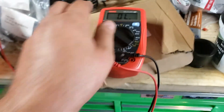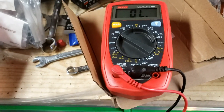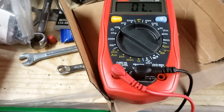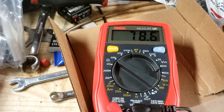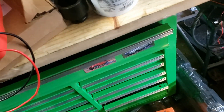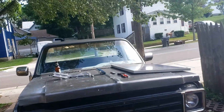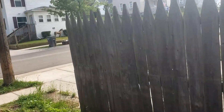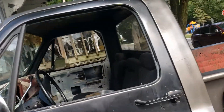When I touched the two leads together, I was able to get a reading that was between zero and 90 ohms. GM sending units go from 0 to 91 ohms max — zero is empty, 91 is full — and I was able to get a reading of like 75, so I knew it was about three-quarters full.